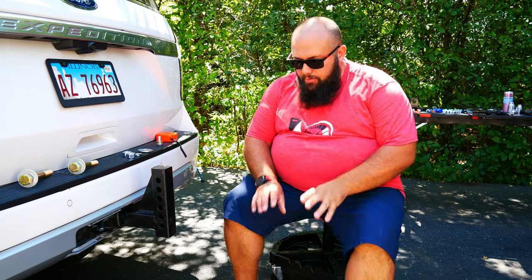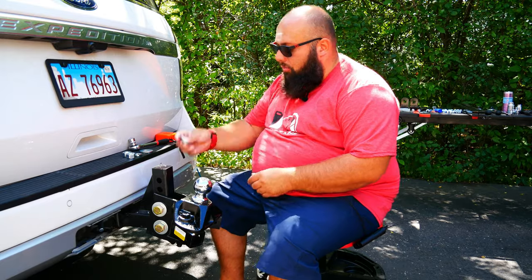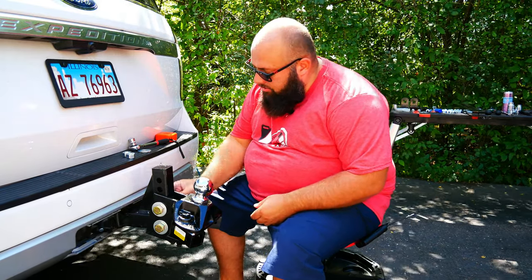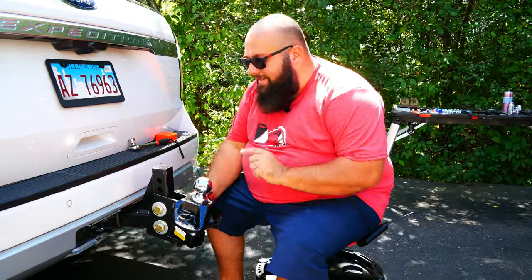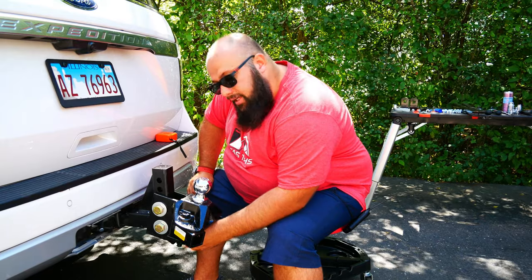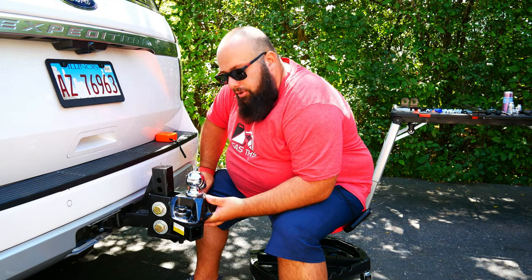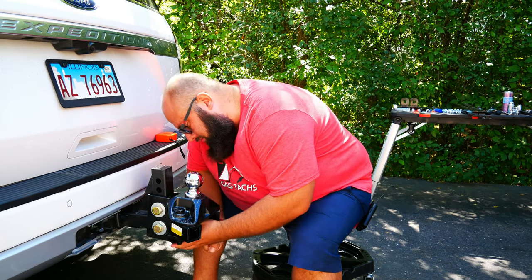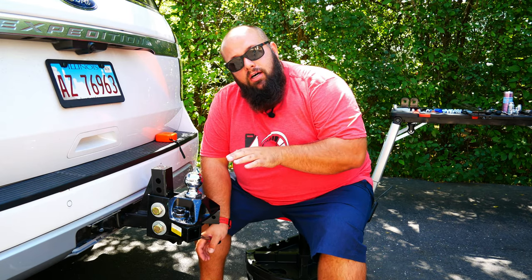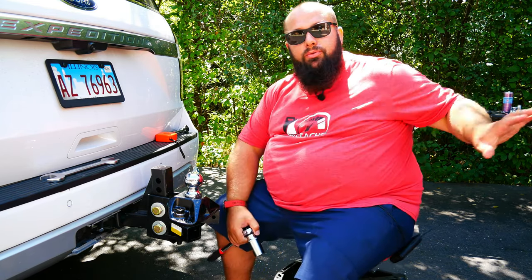Step 3.5 — before you install the hitch, there is a spacer. Equalizer recommends starting with five washers, so I've put my five washers on and it just slips into the back of the hitch. Now that the hitch is loosely installed, put your washer, locking washer, and nut on — but don't tighten it down just yet. There is an adjustable nut on the back that brings the hitch up; tighten it until there is contact, then a half turn more to give pressure. Then we tighten down the big bolts on the back and move to the trailer side.